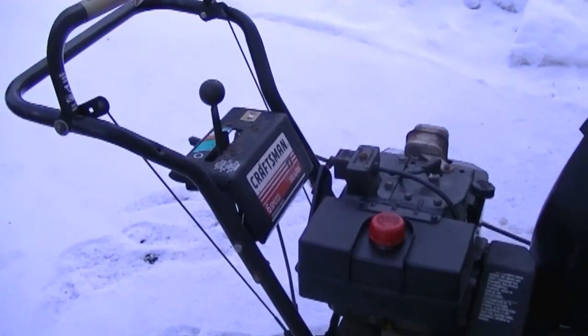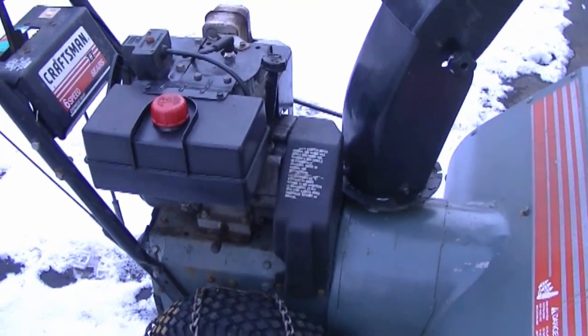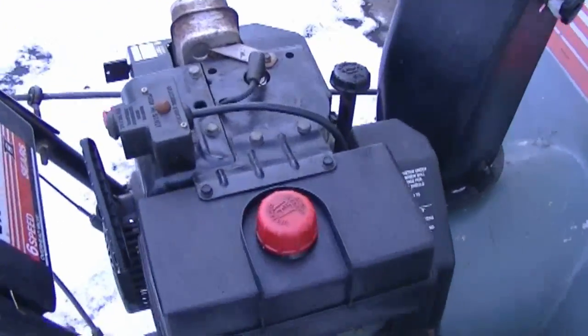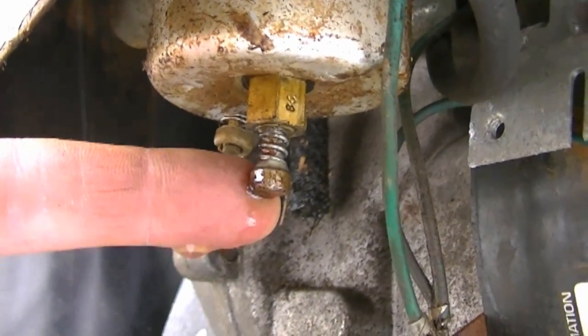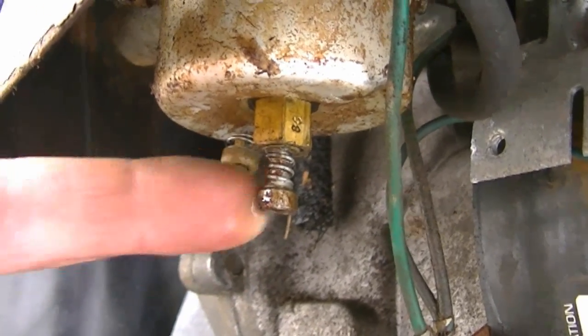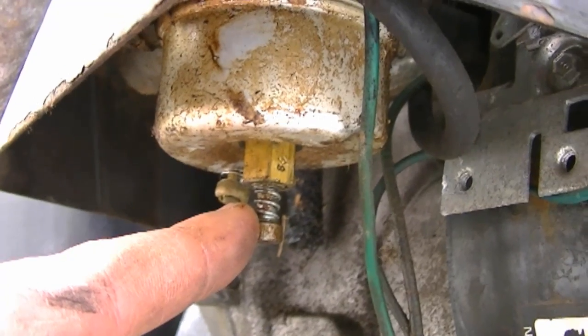To start off today I've got an older snowblower outside. It's leaking a bit of gas from the carburetor — it does have a Tecumseh engine. I'm going to show it to you because a lot of people email me saying their carburetor is leaking and they're not sure what to do. Here's the blower — it's an older Craftsman snowblower made by Noma. As you can see underneath the bowl there's a steady drip of fuel coming from underneath the screw. If you have this problem you need to buy a new carb kit.